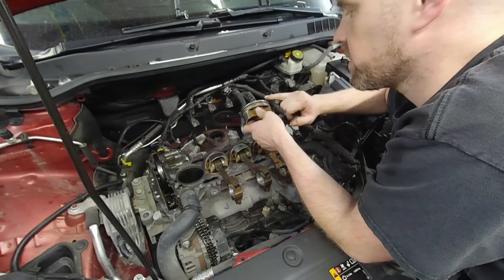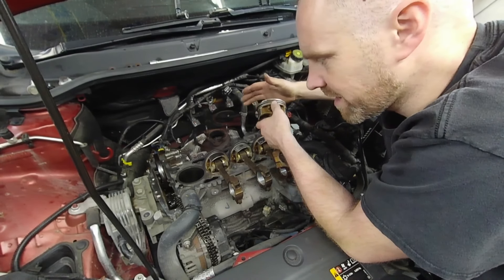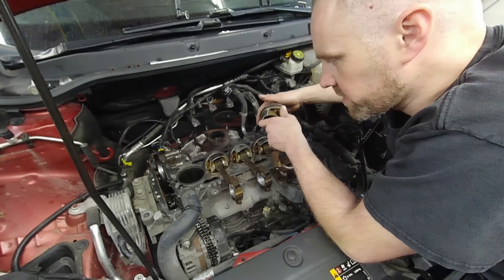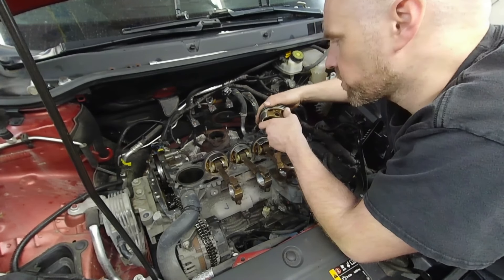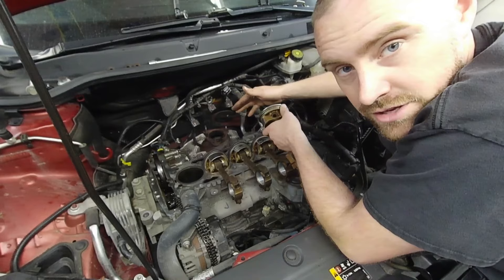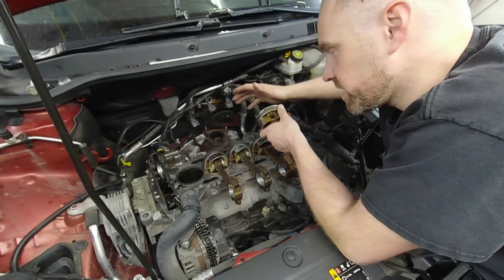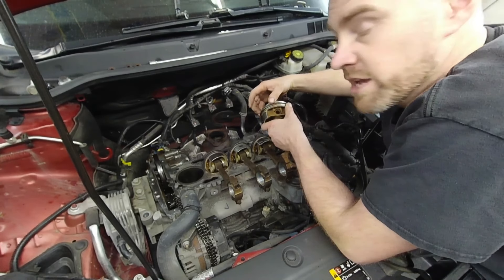Here is the oil, second, and top ring. The measurements I showed you in a previous episode: the second ring was 15 thousandths on the tight side and 20 thousandths on the loose side. For ring gap, a general rule of thumb is four thousandths of an inch for every inch of bore on a stock application. The bore is 3.42, so I used 3.5 in the calculator, which gives a bigger end number and a better result — just over 14 thousandths. So 14 thousandths is my minimum, and the second ring is definitely beyond that minimum.